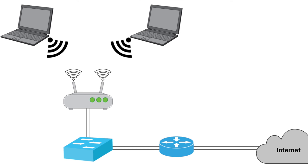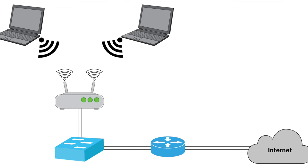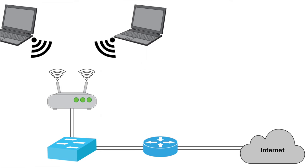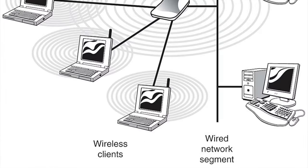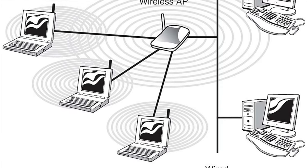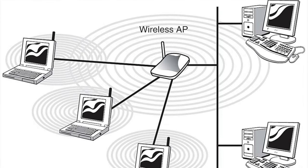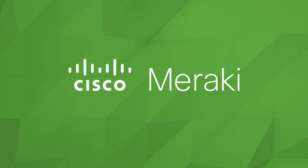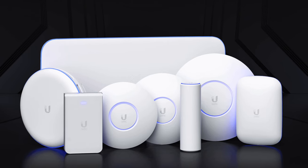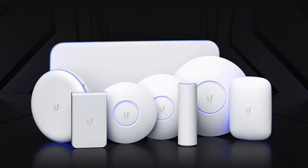In the realm of networking, have a think about your wireless networking. Do you want to stick wireless devices on your network? You can have wireless access points around your house. A lot of these wireless access points can actually be run into a central switch for managing your wireless network. Brands could be like Meraki or Ubiquity, and there are a whole bunch of others. They may also provide Power over Ethernet, which essentially allows you to power on a wireless access point just with a network cable.